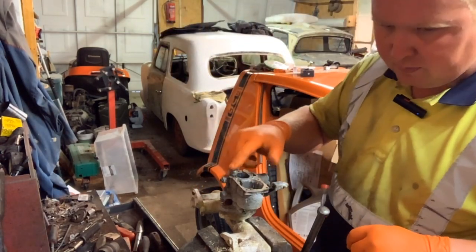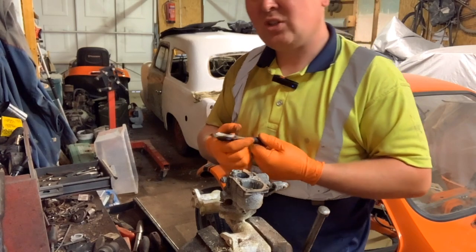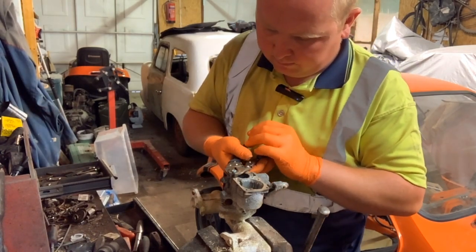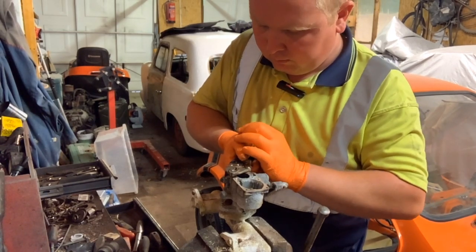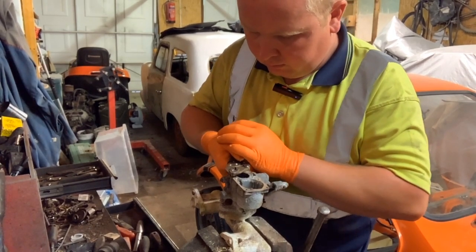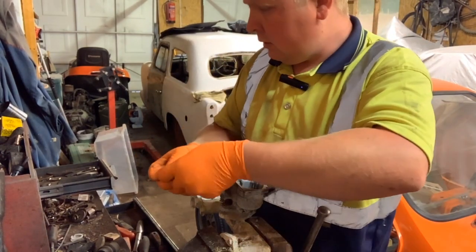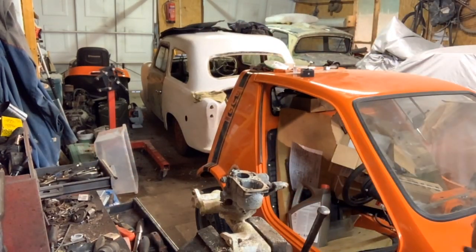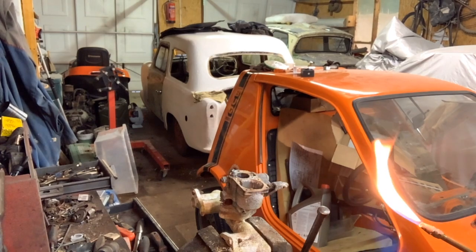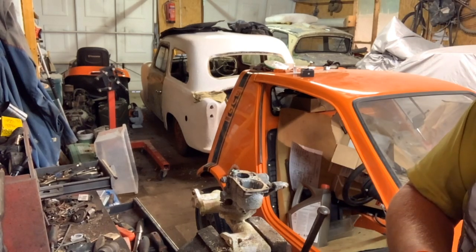Now we're down to this part. I'm going to swap down the size of vice grips I'm using to the littler ones, since it's slightly more delicate bits inside here. Right, so what I think I'll do is, we'll give it a heat again, and we'll use the screwdriver to try and get that jet out. Because we have to be careful with the jet, because it's brass. Oh, I'm still getting used to this kit, you see.